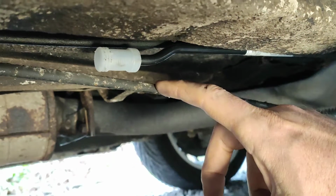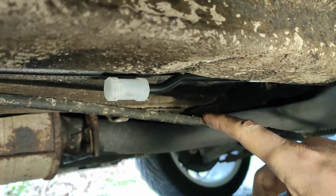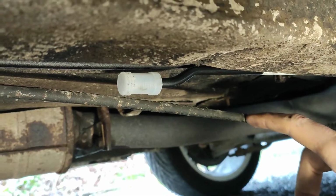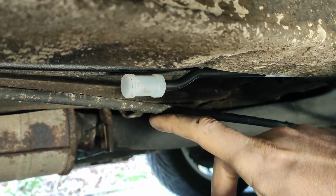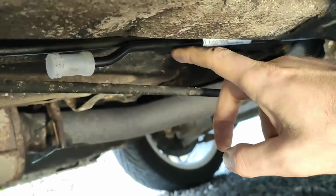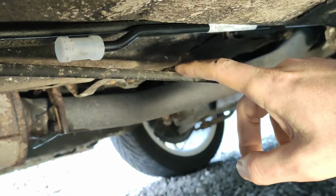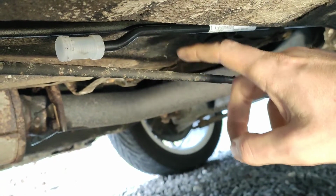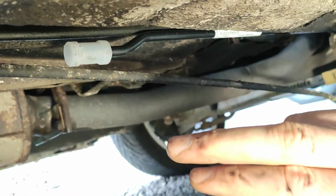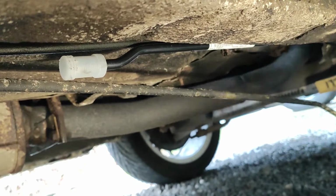So what we're going to do is figure out a nice place around here somewhere where there's a sound bit of metal to cut it, and then cut it just right here as well. I'd prefer to cut it more this way, because if I cut this pipe too short, we're in for a big job. Whereas if the worst came to the worst, we could buy another one of these replacement parts. So let's identify a place. We'll clean it up with the emery cloth, then use the pipe cutting tool to cut this one. Then we'll mark this. I'll need to figure out the required gap that the compression fitting requires, and we'll cut both pipes and try and fit it.